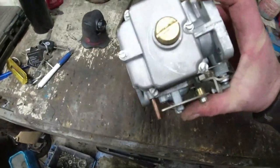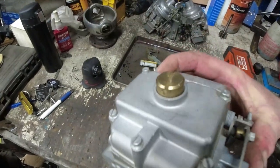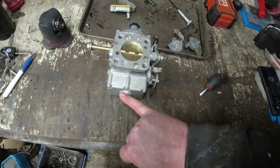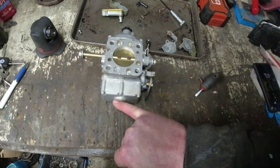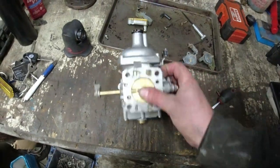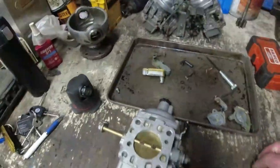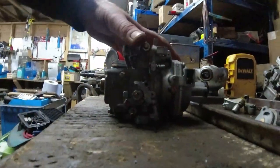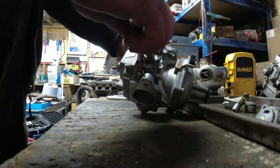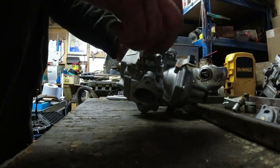Interestingly, this one has got a screw-in plug on the bottom here which does look a bit mangled. Makes me wonder. I'm guessing this would have been the last of the carburetor bodies set up to be tuned through the jet rather than through the metering needle. I'm expecting the top end will be adjusted by the meter needle. Anyway, we're not talking about this carb — we're talking about this choke module.